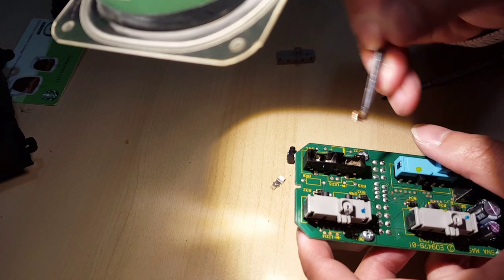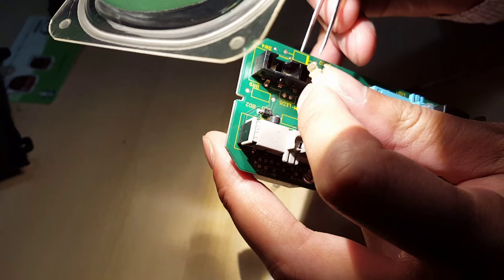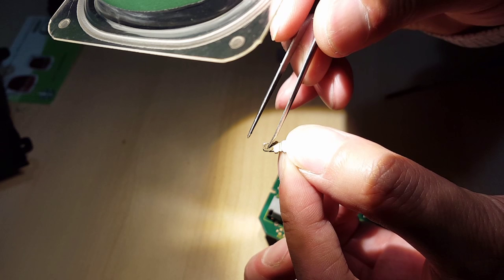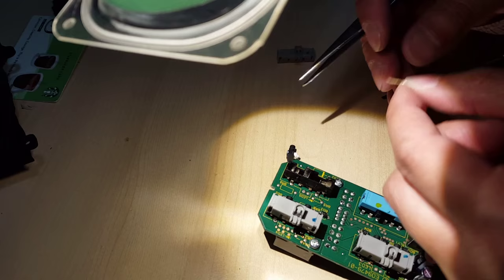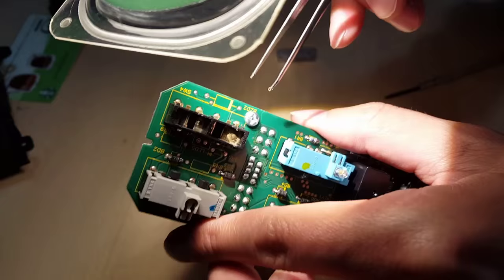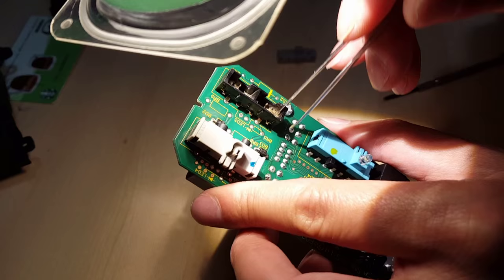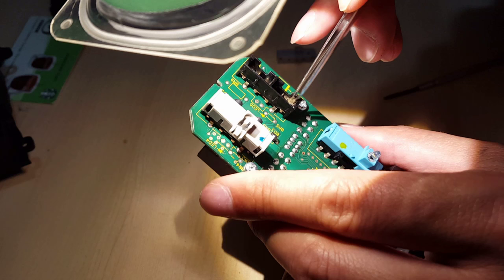Look at that. If your switch doesn't work, there is a layer of oxidation on it. So you could tell from here, there is a bunch of oxidation. See, it's all rust or dirt or something, but there's a lot of it. Scratch it off, and I don't know where this oxidation is coming from, but it's both on the contact rocker switch and on this inside part. If you look down here, this is actually caked full of this oxidation rust type stuff. So we're gonna have to clean this out and check out those. I know there's only this switch that has it, but I'd rather open all of them up since we have it out and just clean out all those and probably put a small layer of dielectric grease or something there so it won't rust like this.